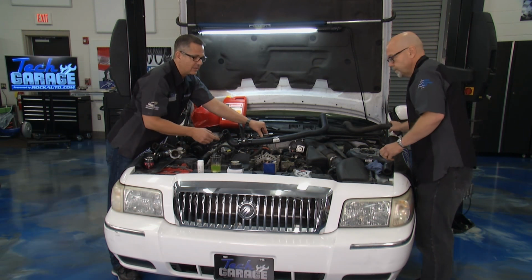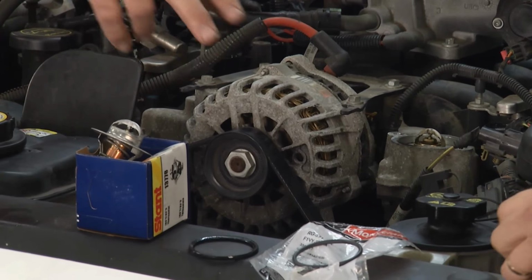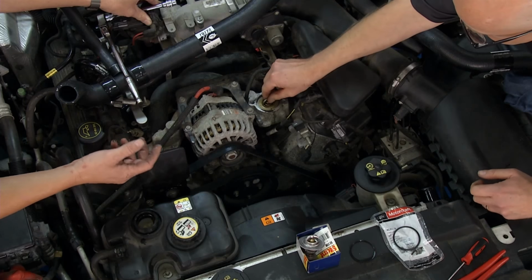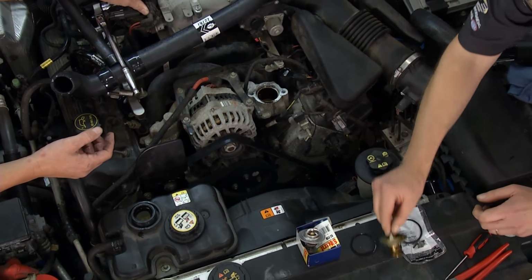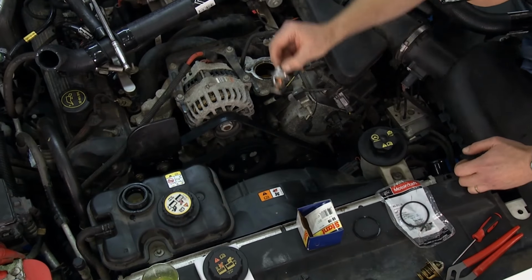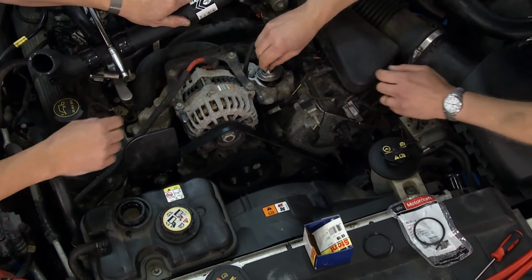Now you just picked out the O-ring. Now we got a new thermostat and we ordered an O-ring as well. That's pretty cool. So once you do that, you grab them pliers there, see, or they're loose. Yeah, once you get that O-ring out of there, you're in good shape. There's the old one. Just match it up to the new one. Yeah, make sure our surface is clean. Yeah, everything looks pretty good. It's nice because we have an O-ring.